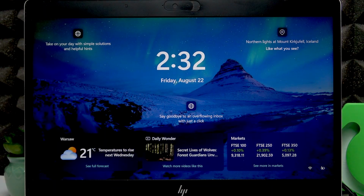If you checked everything and everything looks right to you, then make sure that your device wasn't exposed. If your device was exposed to either extremely hot or extremely cold temperature for a significant period of time, it's very common for laptops in such state to not be able to turn on, since your hardware might be either frozen or overheating, and you should unplug the charging cable in such case and leave your device to rest for up to 12 hours sometimes. Then plug in the charging cable once again and try powering your device on.